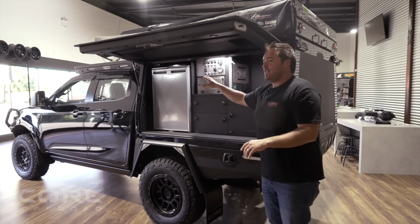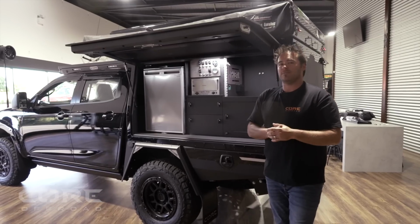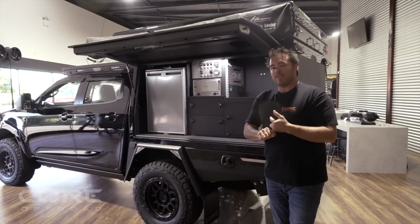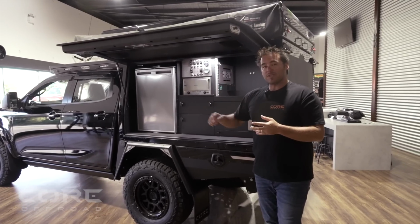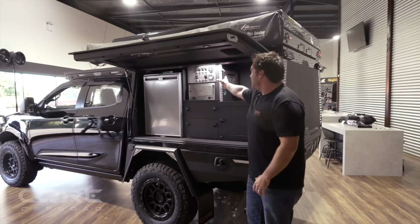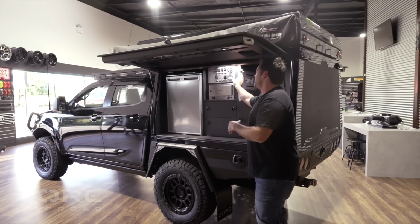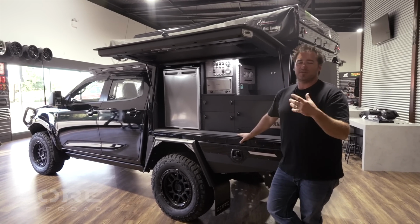Enerdrive system, so the GTX comes standard with an Enerdrive BTEC 125 amp hour lithium battery, Enerdrive DC 40 DC charger, along with the ePro system. So the ePro system's a gauge. It basically tells you how much power you're drawing, how many amps you've used, how long till you've got left, and state of charge, along with voltage and everything else.